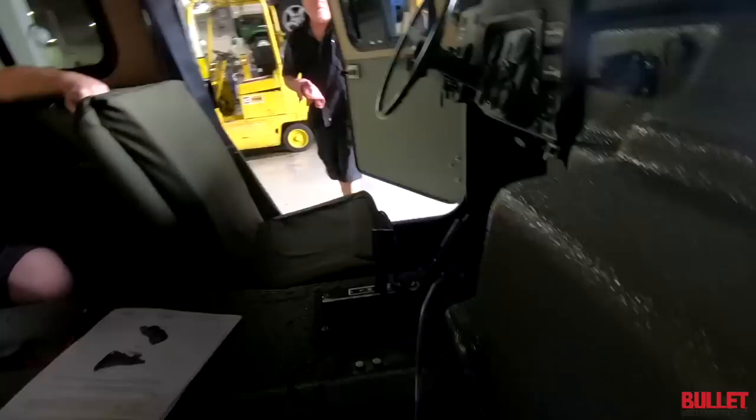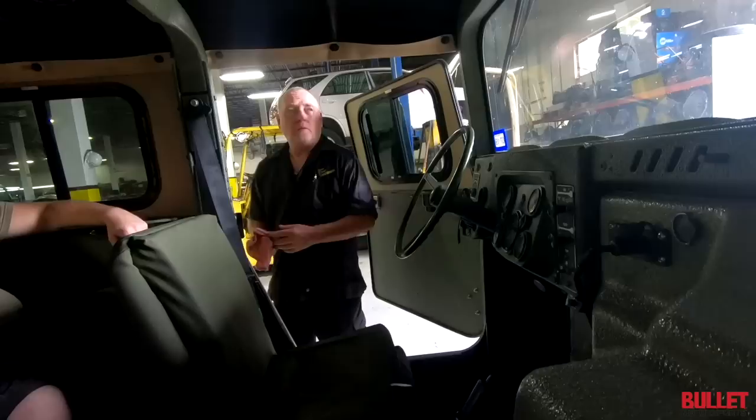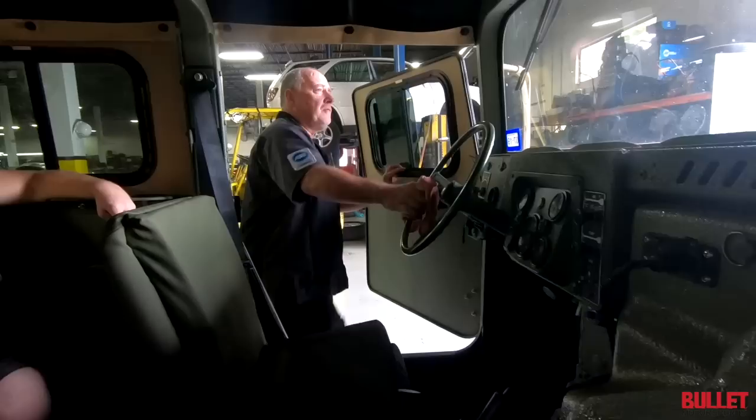What'd you guys put in this tranny? So you did red clutches? Yeah, Red Line. And then, if you're on six, and then five, a different torque. Five. And then a different torque converter. Yep. And a shift kit.